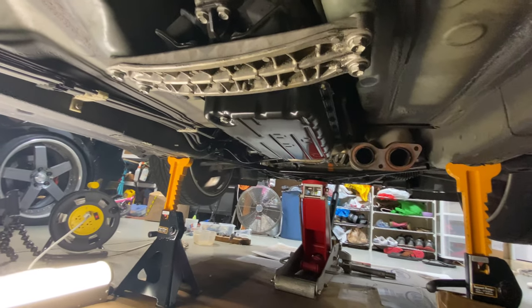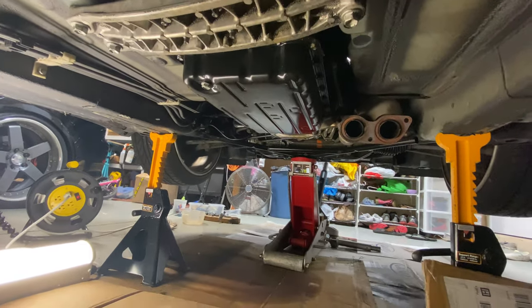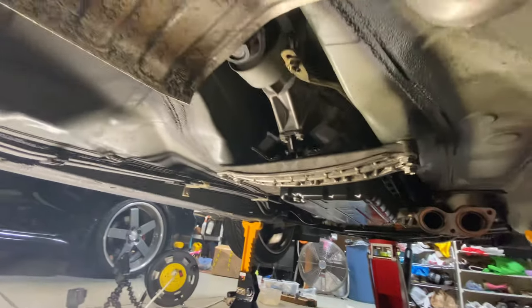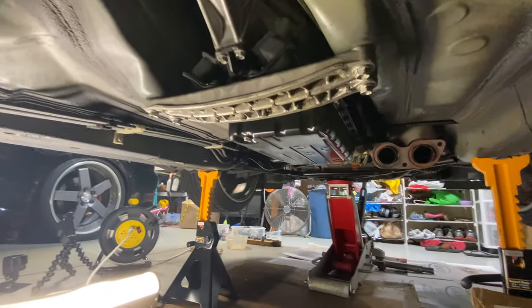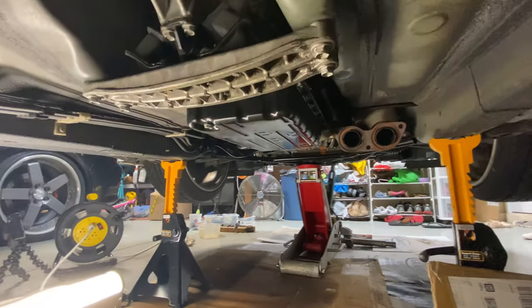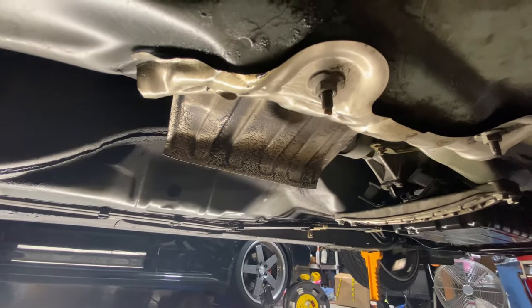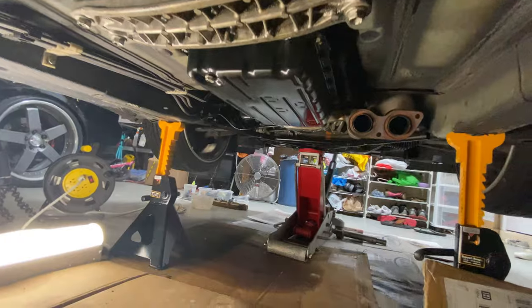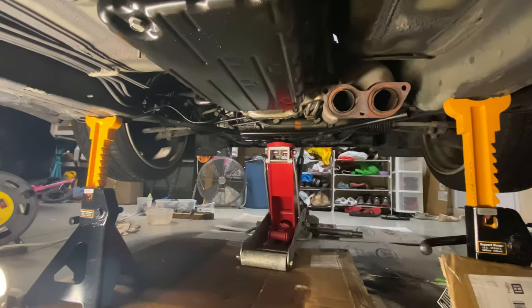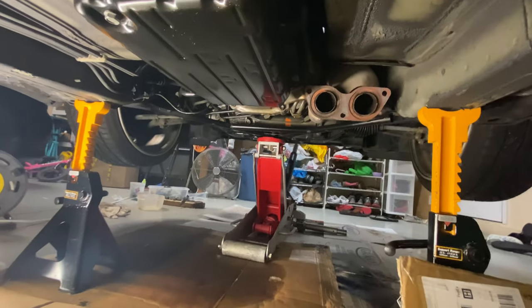Back under the car. I didn't really want to drain the fluid since I'm just taking it down and putting it back up, but I probably need to drain it because once I take that drive shaft out, it's going to leak fluid. I'll end up having to put about two and a half quarts back in as a regular drain and fill. When I drain that, I'll take apart these dust shields, and there's a little panel near the differential. Once I do that, I can drop the drive shaft down and start unbolting the shifter and some of the bell housing bolts to get it ready to drop.